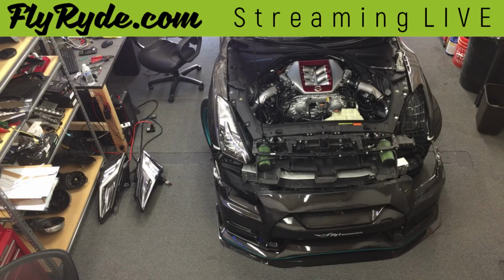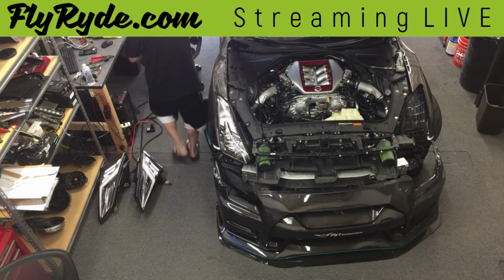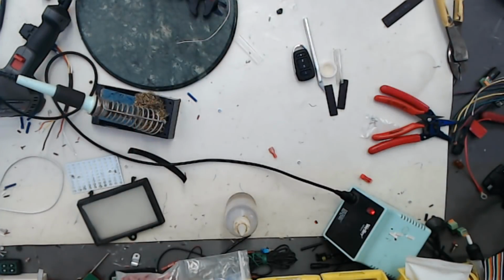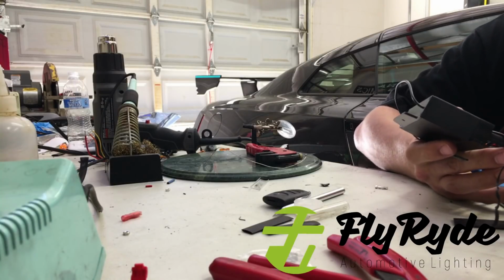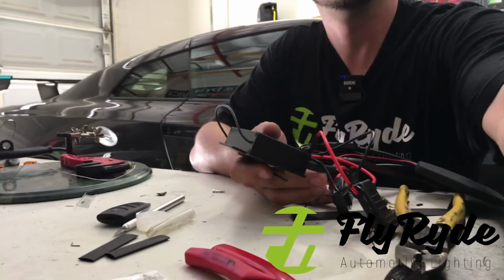All right. My favorite way is to use a patch harness. So on a WRX, like the last video that I did, if I'm using a patch harness, I can do as much as I want to that. I can change all the different connections and I don't ever have to worry about messing something up on the vehicle. If you're doing something on an actual vehicle and you screw up a wire, you're kind of stuck that way.